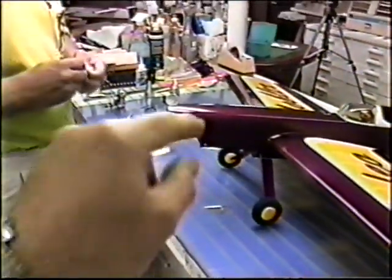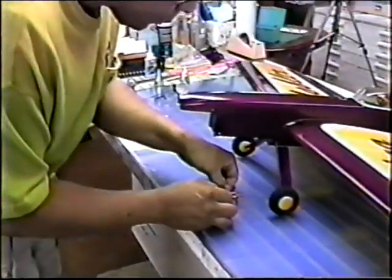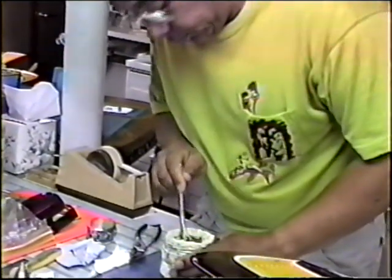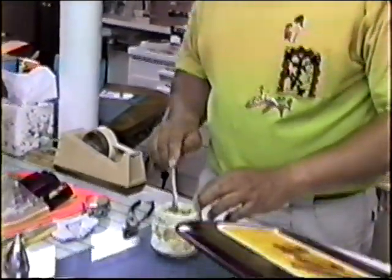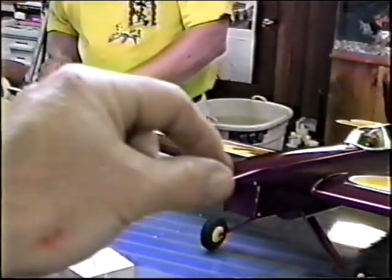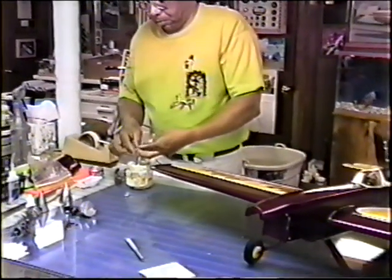We want to get a press fit. I want to have them that they press and they're tight. You don't have a fit where it's dropping and slopping all over the place. Maybe, would you just dip them in there? I just threw them in. Another thing with tank vents, before you put them in, is get all the deburring done so you don't have inside a razor blade that every time you bend the tubing, it's going to put a hole in the tubing, and then you go crazy with lean runs.